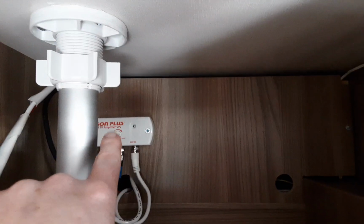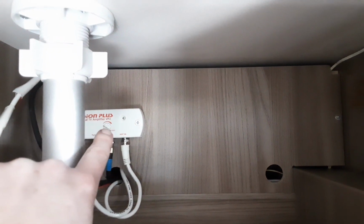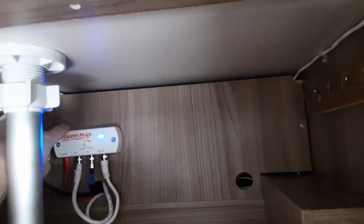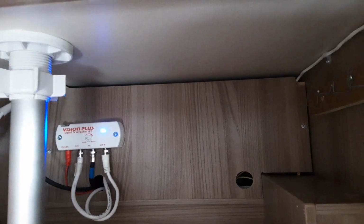On the box at the back there, you will actually notice there's a min and max dial there. Always have it on the maximum. And on top of there, you'll actually find, on this far side of it, a power switch which needs to be on. I don't know if you can see that there where my finger is, on and off. And you need to have it on for the radio boost, the TV booster to work.